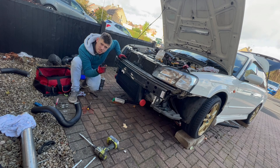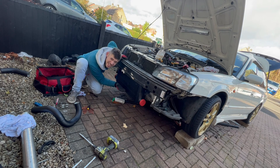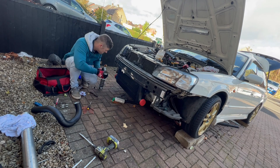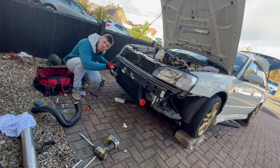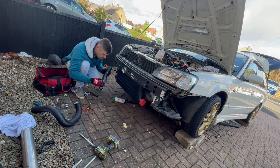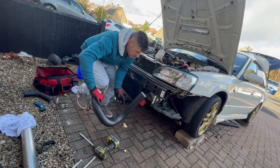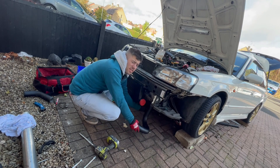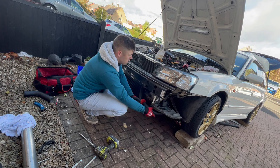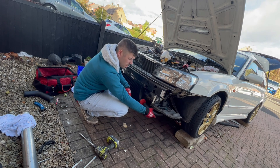With the front bar in position - not as high as I'd like it to be, to be honest. It's a little bit lower than the splitter, the splitter sits here. I've had to cut this piece - this is the one from the side. Obviously the Legacy is longer than the Impreza, so it makes sense that the two pieces that reach towards the front have had to be cut, that being one of them. This one's fine - it's up under there. It depends whether you've got your radiator on or not, or your second fan. But this won't go back in position - we'll figure out how to do that.